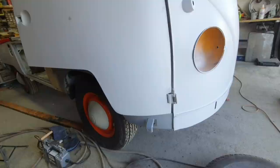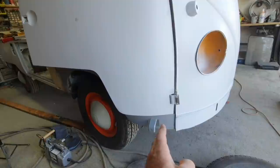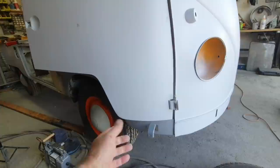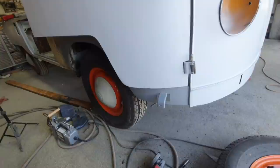But that takes a lot of time. You'd be surprised how many hours you'll have into doing something like that. I would pull the front end in, because obviously it didn't have metal here and stuff like that, a lot of that got splayed over time. Things like that happen. And plus, the dog leg probably is a little off. Like I said, a 32nd plus a 32nd plus a 32nd, everything's a little bit off. And by the time you add it all up, it's off pretty far.